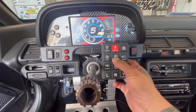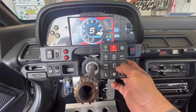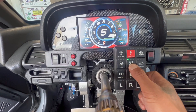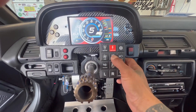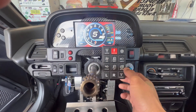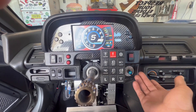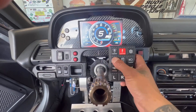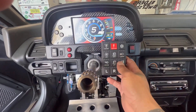In a case where you want to override the fuel pumps — say one pump is clogged and you want it on continuously instead of being triggered by boost — you can override it and run it home. Same with the fans: if the ECT sensor goes out, the ECU doesn't know when to kick the fans on, so you can manually override the fans. Same with the water pump for the air-to-water intercooler, controlled by intake air temperature via thermostatic switch.